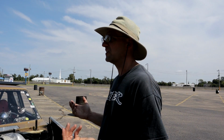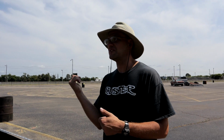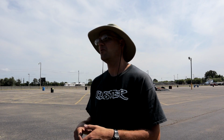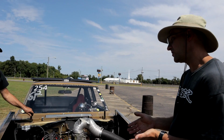So I was at Clay City for a Slant Six race one year, and I go up to tech, and I noticed there's no oil pressure. The night before at Test and Tune, I had to put a plastic distributor gear on. It was cracking and popping, and the car had run great before that. Well, what was happening was the drive gear on the cam was shearing, which is common on these. So I wanted to keep the cam.